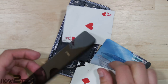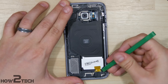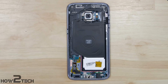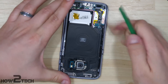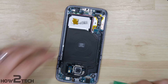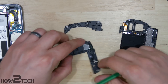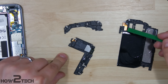Ta-da! Now we're going to go ahead and remove the 12 screws off the back of the phone, highlighted in yellow. Peel up the little gold flap and remove the plastic backing off the phone. This portion is the loudspeaker; the portion above is the wireless charge mat. Be careful because these make connection with the logic board — you want to make sure they'll still make connection so you can still use them. There are also antennas on the back that help with cell reception, Bluetooth, and Wi-Fi, so do not damage the logic board connections underneath.